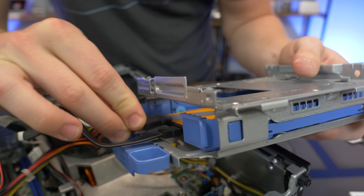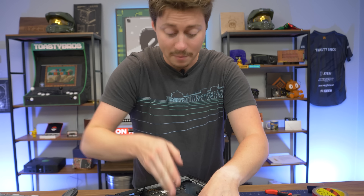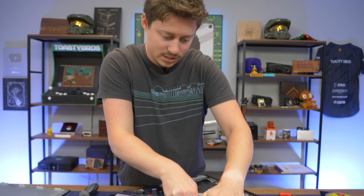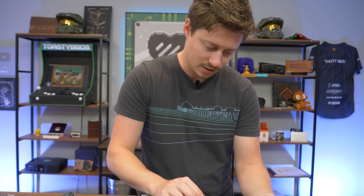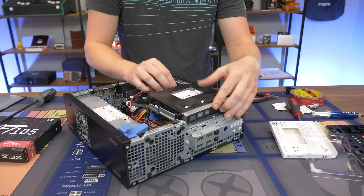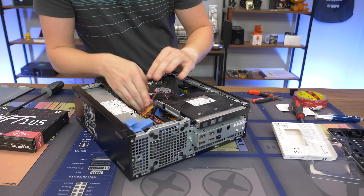This is our power cable for the SSD. If you ever wanted to add a nicer card with these Optiplexes, the best you can do is a low-profile card. But if you have a bigger full-size MT system, you could get a full-size card like a 1050 Ti or 1060 with external power via a SATA adapter and six-pin connector. I had a guy come in running an Optiplex with a sixth-gen i5 and an RTX 2060 — pretty wild build.